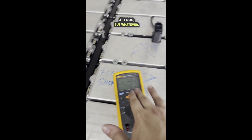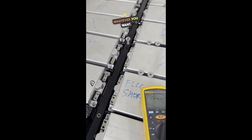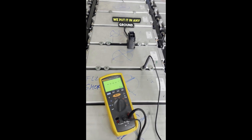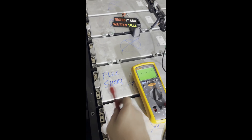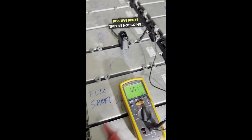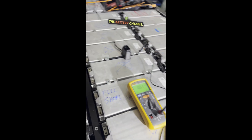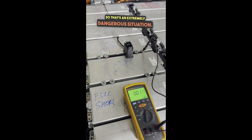So now we grab our Fluke 1508 isolation meter and set it to 500 volts. I know this is an 800-volt battery so we should test at 1000, but if it leaks at 500 it's going to leak at 1000 and vice versa. We take the negative probe and put it to any chassis ground, then probe the module. This one: 0.01 mega ohms — that's terrible. All the 500 volts we're sending from the positive probe are not staying here; they're going throughout the battery chassis. The same happens when you drive or charge the car — the battery frame is fully live. That's an extremely dangerous situation.